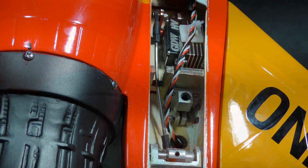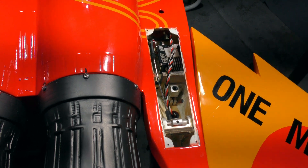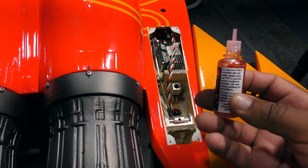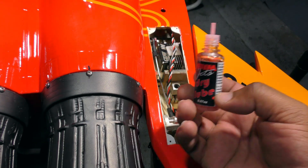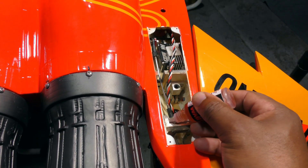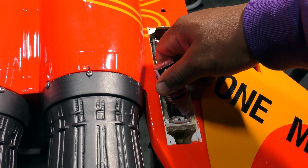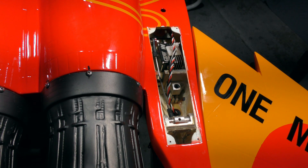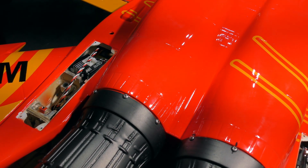There's nothing much to see here other than the rudder clamps and all the servo connections in the back. In here there are bearings — you can see your stabilator rotates right around here and here. I noticed it was a little dry, so I got some BVM dry lube and just dropped a few dollops in there to keep the bearing nicely lubricated. We'll repeat that on the other stabilator and then move on to the vertical stab.